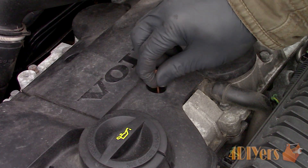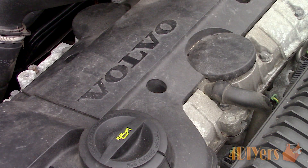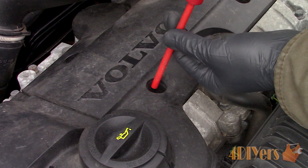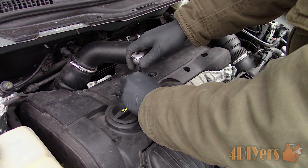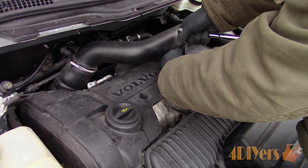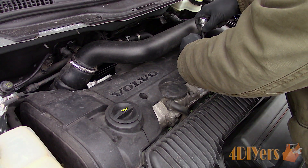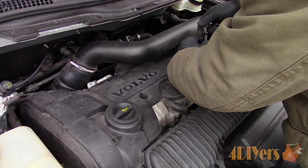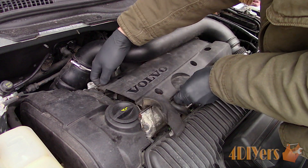To remove the engine cover, it comes out in two pieces. Using a small pick, I like to clean the heads of the fasteners first so the bit has good contact and we don't risk stripping the shallow head. I'm using a rubber blow ball to remove any debris. There will be 6 T30 Torx head bolts in total on the larger cover. A 3/8 drive ratchet with a 3 inch extension gets access to all these bolts easily. You may need to push the pipe around to gain access to the two rear bolts. Then pull the cover up, direct it around the pipe and remove.